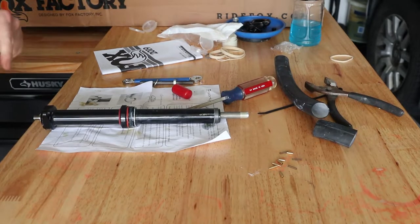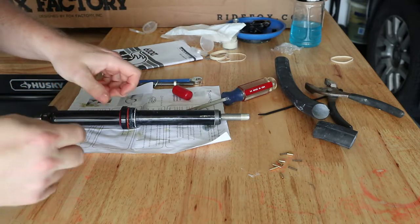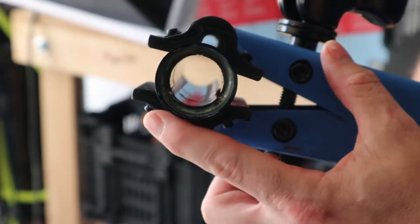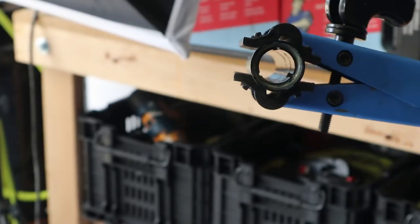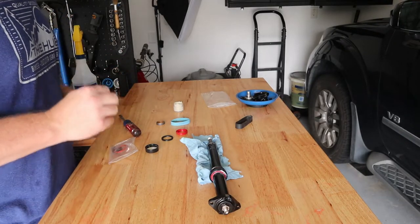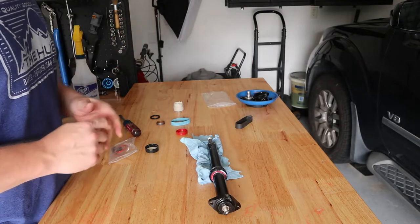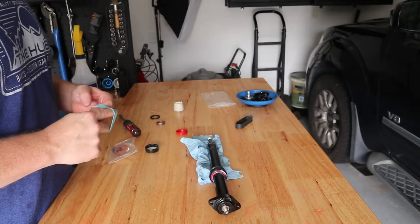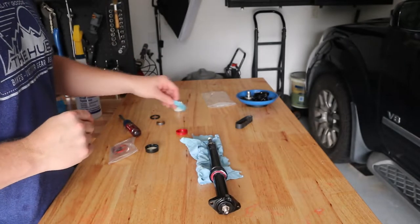This is probably the most frustrating part of this build. The key is really to use rubber bands to wrap around the keys very tight. There are three key cutouts that match the top tube, and we want to align those when we're inserting the tube. I had to stop and find my other V2 collar nut and foam ring because I messed the first one up — I already had an additional rebuild kit. I think it matters a lot which rubber bands you use in order to hold the keys into place on the shaft, so I sourced some different rubber bands hoping they're tighter and will work better.